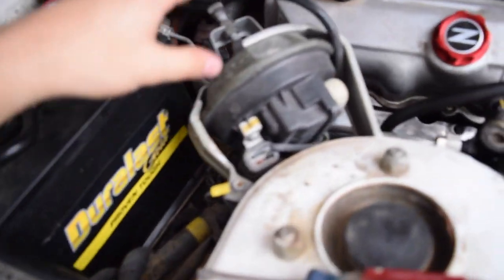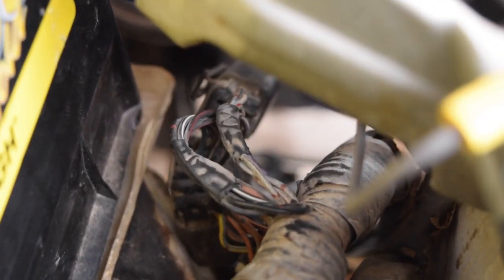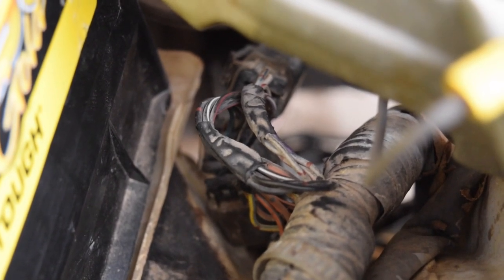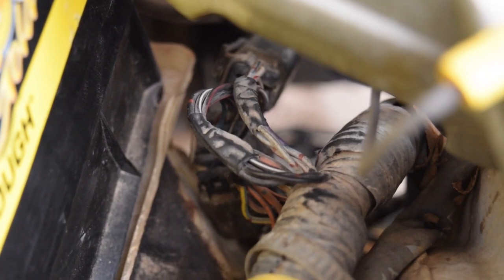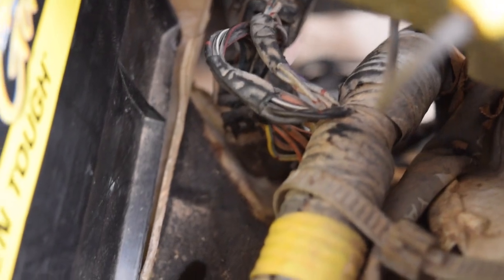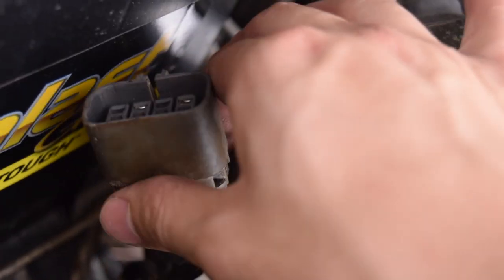The last thing pertaining to the swap is wiring. Over by the battery tray, you can follow some lines to a main wiring harness that sprouts three connectors. Note that the '84 is a different wiring year, '85 and '86 are grouped together, and '87 through '89 are another group. I have an '86, so I'll be following that. I refer you to the xenonzcar.com write-up — I'll put a link in the description. For mine, there's an 8-pin connector that I need to work on.